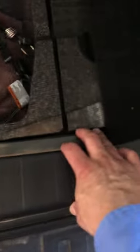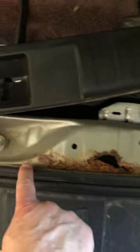Anyone thinking of buying a 2013 and newer Subaru Outback, check the back trunk cover or tailgate cover, storage compartment cover for signs of rust. If you find that, pull this trim panel up. Put your hand underneath and pull and check it for rust.